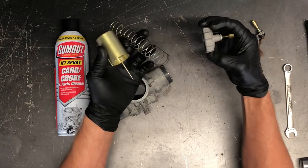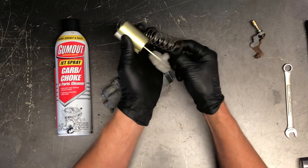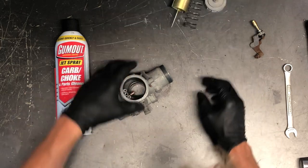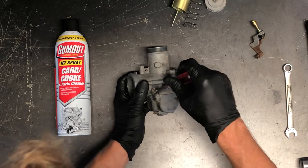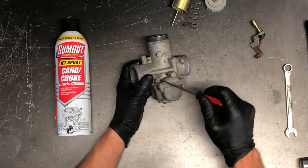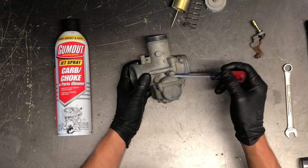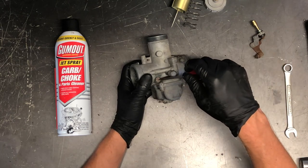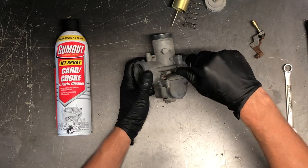Your spring will slide down the end of your cable, and then you can unscrew either the top of this cap or — in this case — the cable comes out of this threaded area. So that is the top of this carburetor. We have your air-fuel screw here, and you adjust this very, very slightly if your motorcycle isn't running right. When you set it up to factory specs, what you do is count how many times you screw this in until it's completely seated.